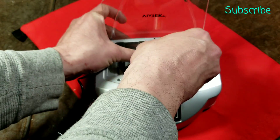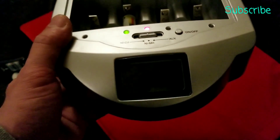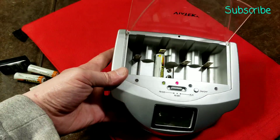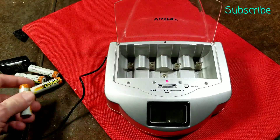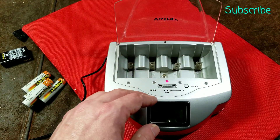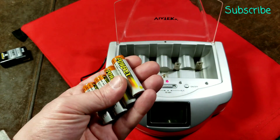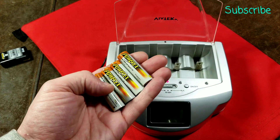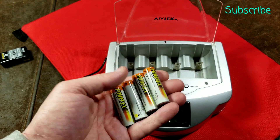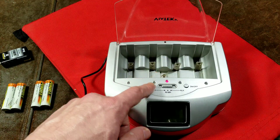These are pretty dead — they've only been charging for a few minutes. And yeah, it did it. Those aren't charged batteries; they were just charging. But as soon as I pulled them out and reinserted them, we can see it immediately went green. When it's done charging it switches from charge to say OK. That's really what makes this charger frustrating and not very useful for standard rechargeable batteries — it has extremely sensitive, extremely low voltage thresholds. So it won't cause fires, but it doesn't do a very good job charging these batteries. It will seem like it's charging and then 20 or 30 minutes later turn green and say it's finished, even though the batteries are only a third charged. It just does not deliver the power properly.